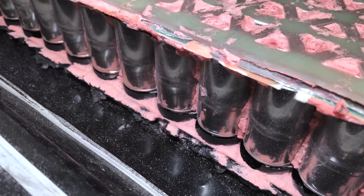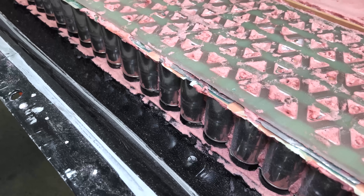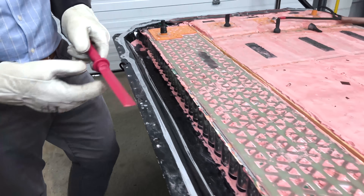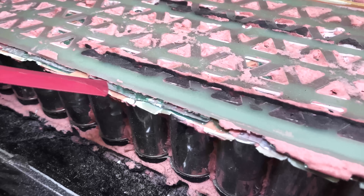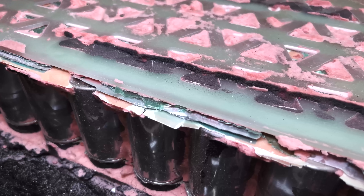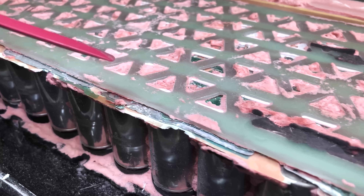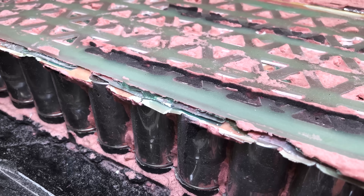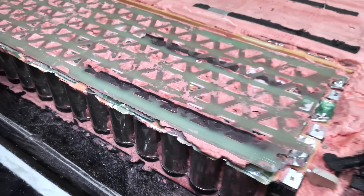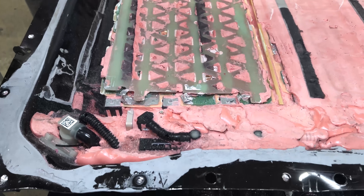The vents are on the bottom side of the cell, so if you have an overcharging scenario or something going wrong, it's going to vent downward. These pieces right here are the collector plates and bus bars connected to the top of the cells. We haven't been able to remove this upper plastic piece — our team thinks this is nylon, given the heat and durability requirements.